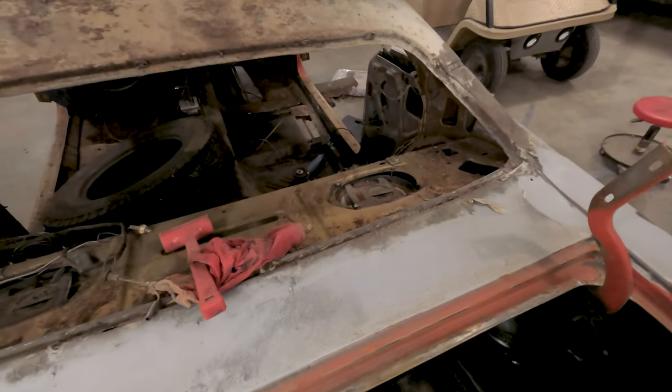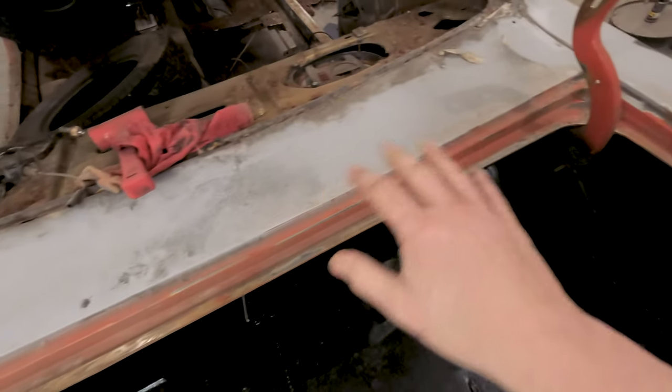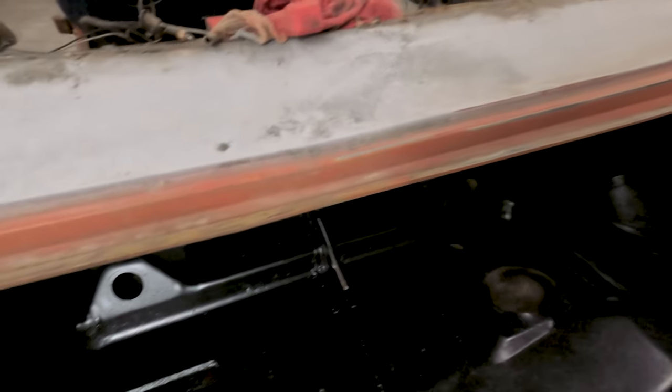I've been doing that with the floor pan — you can see the hole here as I've been trying to cut around where the spot welds go. So when we do get the bit back in, it's a lot easier to manage. I'm also trying to be aware of any structure under here. With the floorboards, we've got plenty of bracing for the frame itself and I don't want to cut through that. So I've been trying to make marks of where any other supporting structure is in here, but I don't think there is any, this being just a filler panel with nothing too important structural-wise.